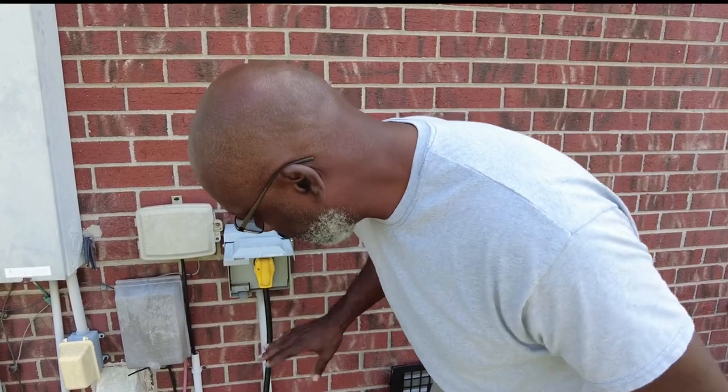One of the first things that we do is we plug our camper in. We have a 30 amp outlet here specifically for the camper so that we can run the air conditioning and check all that kind of stuff. If you don't have a 30 amp you can plug it up to a regular household 20 amp socket and check some things, but you can't run both air conditioners. We make sure we've got power and turn the refrigerator on.